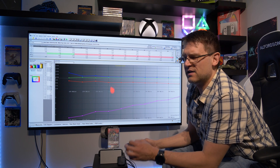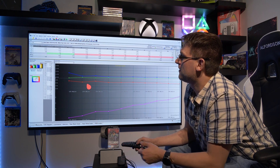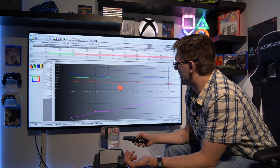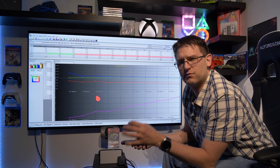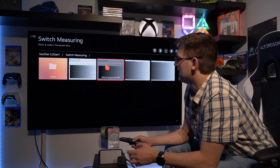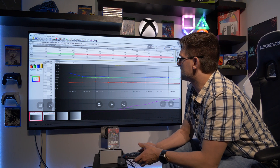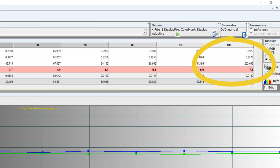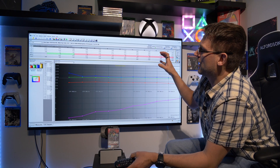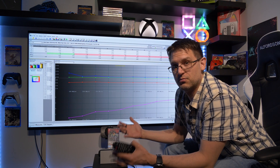The only thing right now is that red is a little bit too under-saturated. We need a little bit more red to get a better color temperature. Blue is also a little bit too much, but that's not too bad. But red is absolutely under-saturated — we'd need a touch more red for a much better result. I also tried different brightness settings to see if there's a change in the grayscale. At 200 candela there's not much difference. Unfortunately, we can't change the grayscale outcome by changing brightness — it's not working.